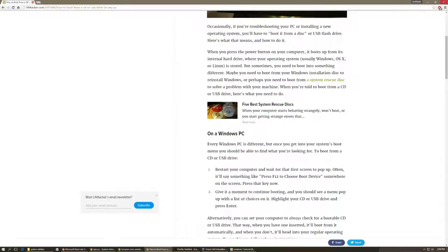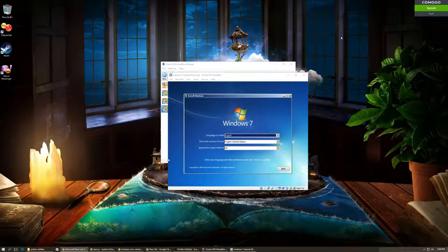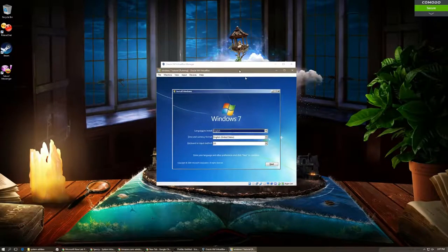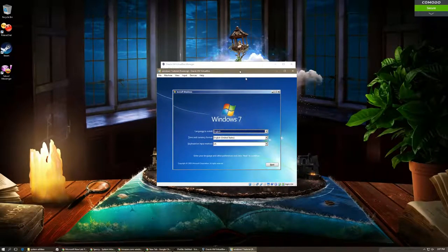Or no, not, you're going to format the drive, but it'll tell you which one to recommend. It should be NTFS. I'm not sure. I forget what I use for Windows 10. I'm sorry, guys, but it'll recommend you one. So you pick the recommended one, you format it in that format, and then when that's done, you can create a new partition. It'll tell you the default size to make it of your drive.